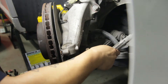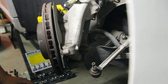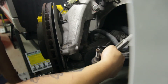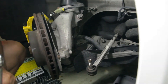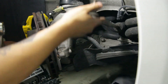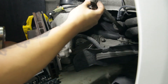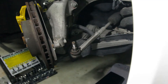I'm going to unclip this boot real quick. You can also kind of tell that the inner tie rod's bad because of this - if you had a good inner tie rod, there'd be a little bit of resistance. You see how it just falls? A good inner tie rod would sort of slowly drop with a little bit of tension on it.